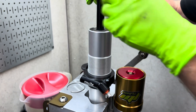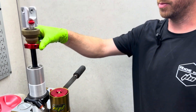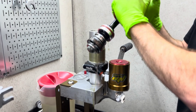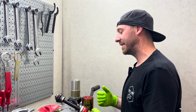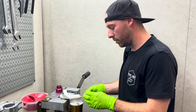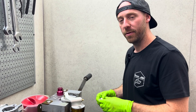We're going to clean out inside the seal head area before we extract it from the cylinder, because any dirt or debris in there is going to be very counterproductive when removing the seal head. Not a lot of time on this shock — as you can see the oil is still pretty clear — but we did enough testing to know that the setting in this one wasn't as favorable as the other setting, so the shock's been sitting in the drawer for a while. Right now we're removing the clickers from the compression assembly so we can remove the compression adjuster assembly and make some adjustments to the valving and possibly some other hardware in there as well.